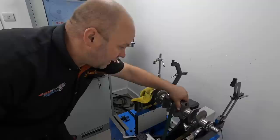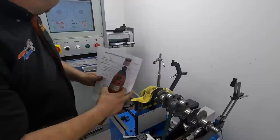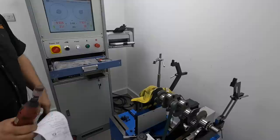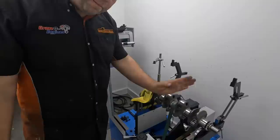I'm balancing the Formula Ford crankshaft assembly today because the engine's got to be built. I've already run the crank up to get some basic figures and as a static mass it's actually in balance. The machine is showing green in the middle, but the red on both ends means the front and rear are slightly out. The first thing I'm going to do is remove a little bit of metal from the two areas of the crank that need it, get the crank closer to balance, then bolt the other components on and keep balancing.